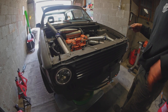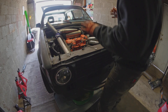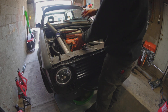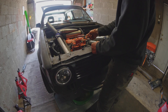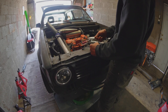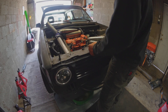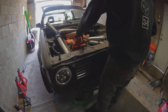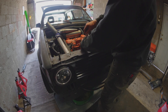Now that the gasket maker's on the ALH and setting up, I'm going to put the gasket on the pump — it's teardown time. I just pulled my lower coolant hose. The first thing I'm focusing on and trying to extract is my fuel pump — I want to get the pump out, get it reset, and attached to the 1.9. In order to do that I'm going to start a soft teardown: pull the radiator hose because it's in the way, pull all my intake piping because it's in the way too. Then I can focus on the fuel pump aspects like the timing belt, injectors, etc.